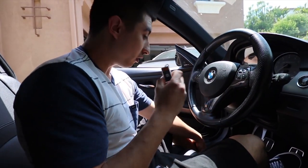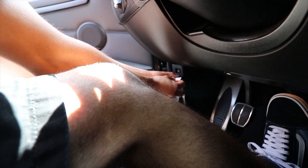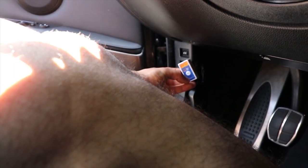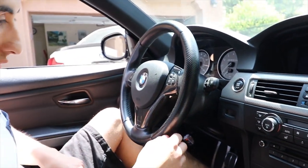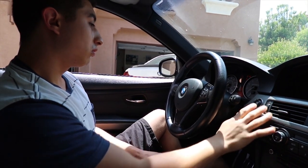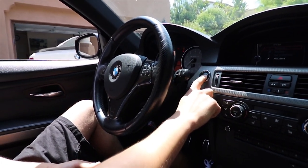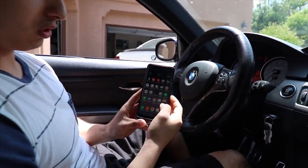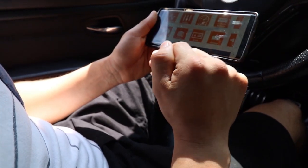With the Carly adapter, we've got to go ahead and connect it at the OBD2 port down below, wherever yours is located. Connect it, and if the light's not on, make sure to turn it on. Put your key in the ignition, turn it on - don't turn on the car all the way, just put it on accessory.